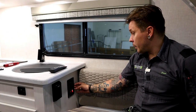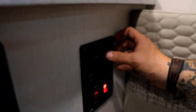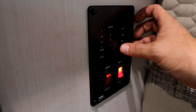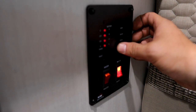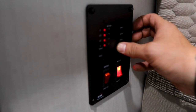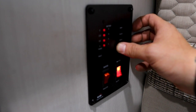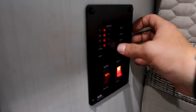to the right of that, we have your courtesy panel, convenience center, it goes by many names. We have these tank monitors up front. Those tank monitors have been referenced throughout this presentation. Battery is going to read full anytime you're plugged into shore power. To get a true readout of where your battery sits, you need to unplug from shore power and then test here from this location.